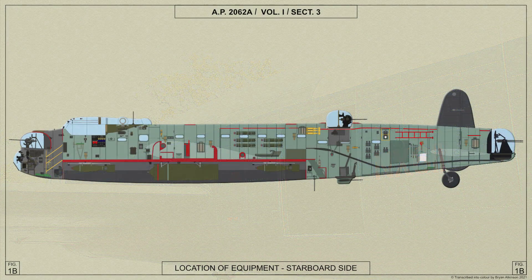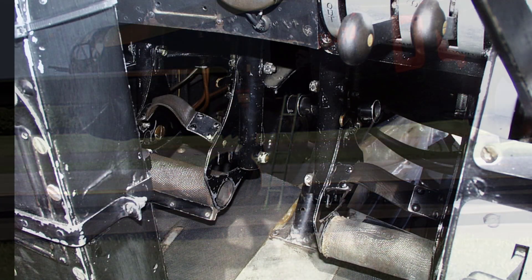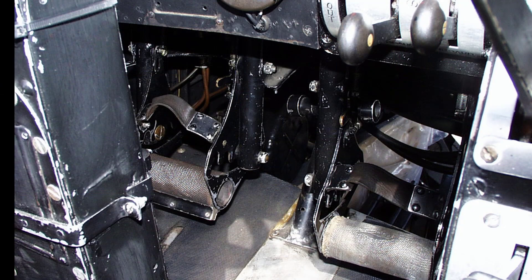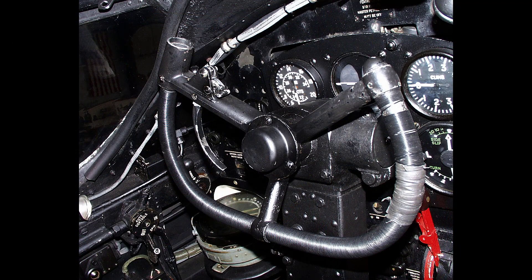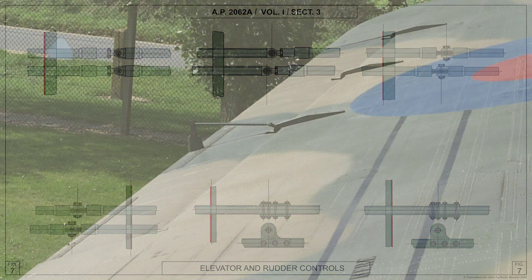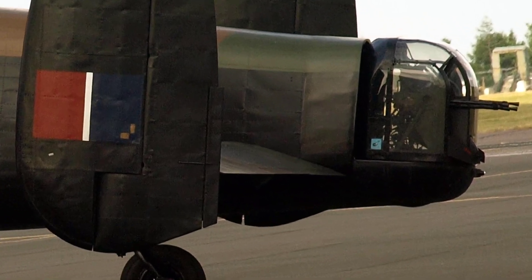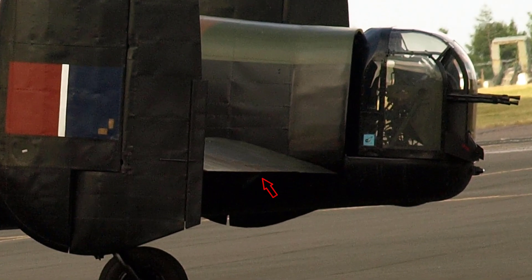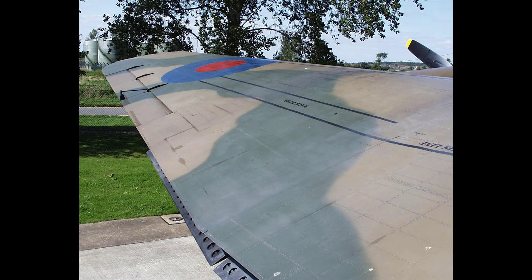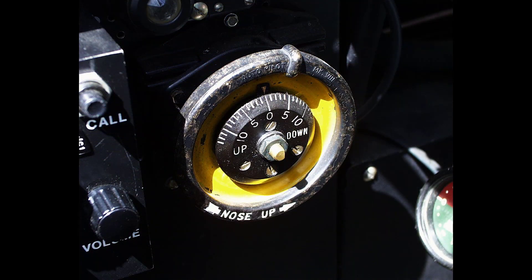The entrance door is on the starboard side of the fuselage just forward of the tail plane. The door opens inwards and an entrance ladder, stowed inside the fuselage above the door, is hooked to the bottom of the door frame when the door is in use. The flying controls are conventional pendulum type rudder pedals operating the rudders and a hand wheel type control column operating the ailerons and elevators. Tubular push-pull connections are used except for the aileron controls in the fuselage which consist of chains, tie rods and cables. Trimming tabs are inset in the trailing edges of the rudders, elevators and ailerons, and balance tabs are fitted to the elevators and ailerons. Mark IV automatic controls are employed.